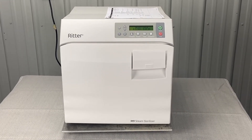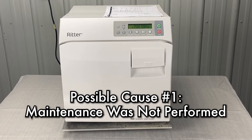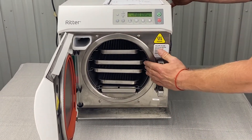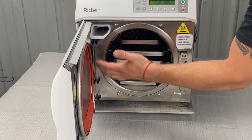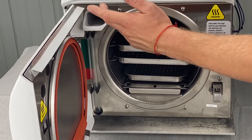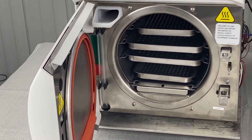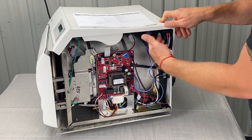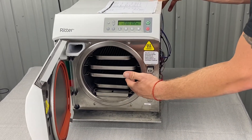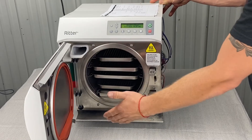Number one we're going to look at is maintenance not performed. Verify weekly and monthly maintenance has been performed by the customer — refer to the user guide. Weekly and monthly maintenance includes draining the reservoir; that has to be a regular thing. If you constantly are adding water on top of the old water, you're going to build a biofilm. It's going to clog your valves, your fill vent, your air vent bellows in the back, get residue on your heating element and temp sensor, causing all kinds of issues. So drain your water regularly.